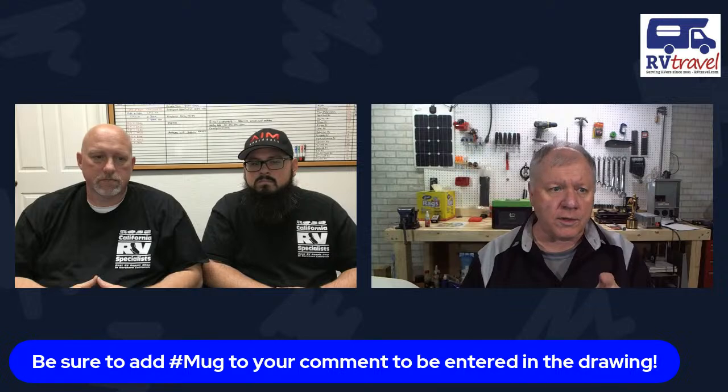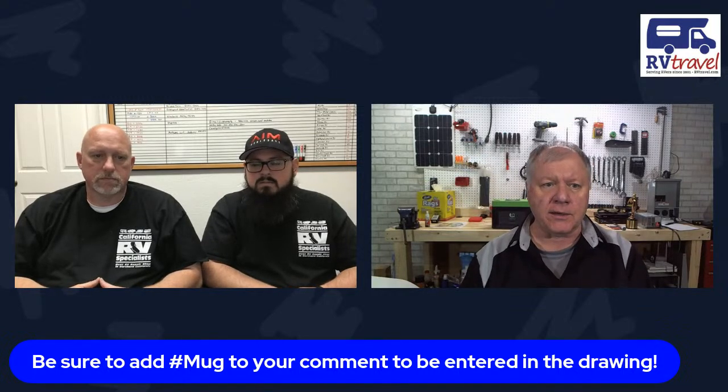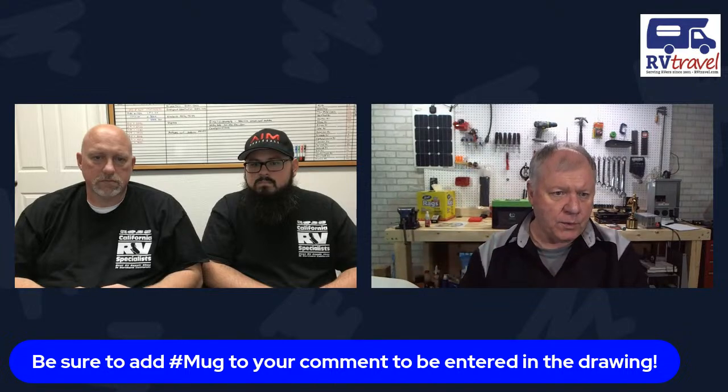Good catch, Zach. But to get back on Snoopy's topic on that Danfoss, I sent you the link today. Mike Sokol did a really nice job of reviewing that Danfoss compressor driven 12-volt refrigerator. He said he got 36 hours out of a 100-amp lithium battery, 3 times what you would get from a residential. From his article, if you have a residential refrigerator that runs on 120 power through the inverter, you're losing a lot of energy, rather than getting a 12-volt style compressor driven refrigerator.